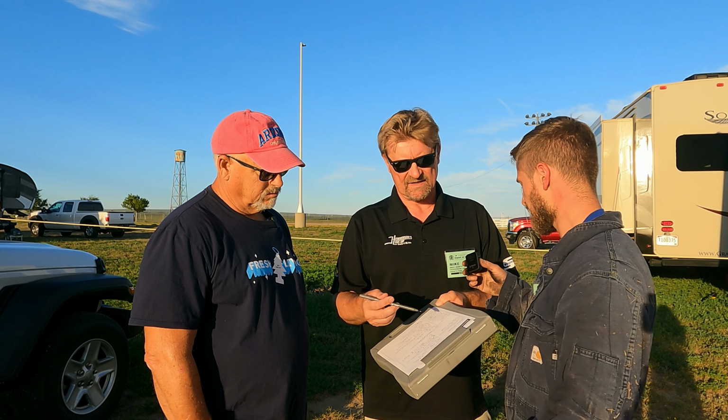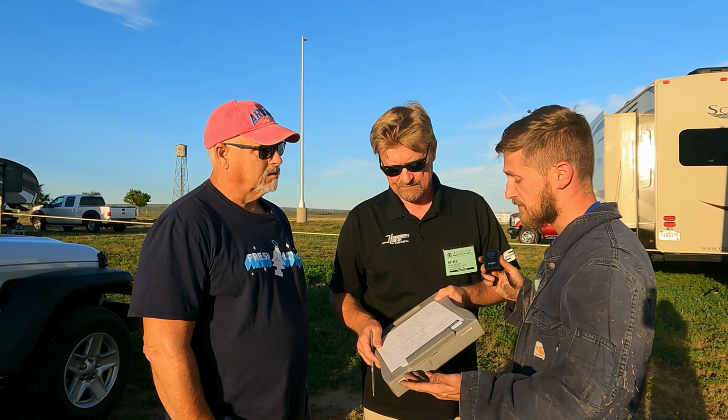And because you've got a Safety Plus on it, it's probably masking over what it's really doing. Yeah, okay. Good point. So you do already have a Safety Plus steering stabilizer, which is great. That's what we would recommend you put on there if you didn't already have it. It looks like it's been on there a while, but appears to be in good condition. You can always check to confirm that by raising the front wheels off the ground and turning the steering all the way to one direction, and then let go, make sure it snaps back on center, not too fast, but fairly rapidly, and then precisely stops center, and then do the same in the other direction.